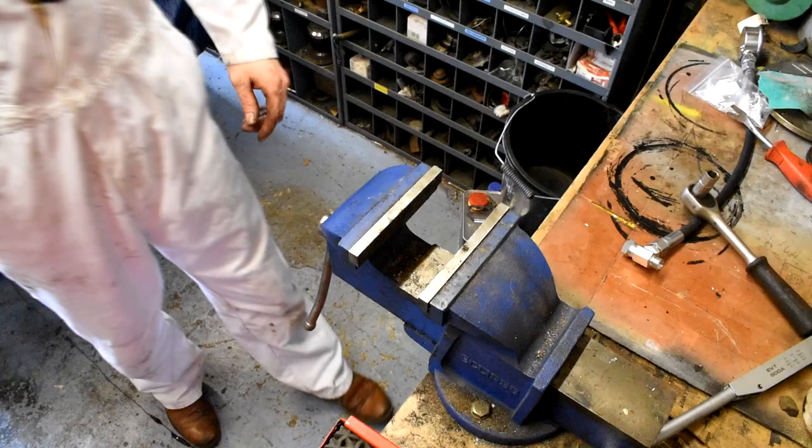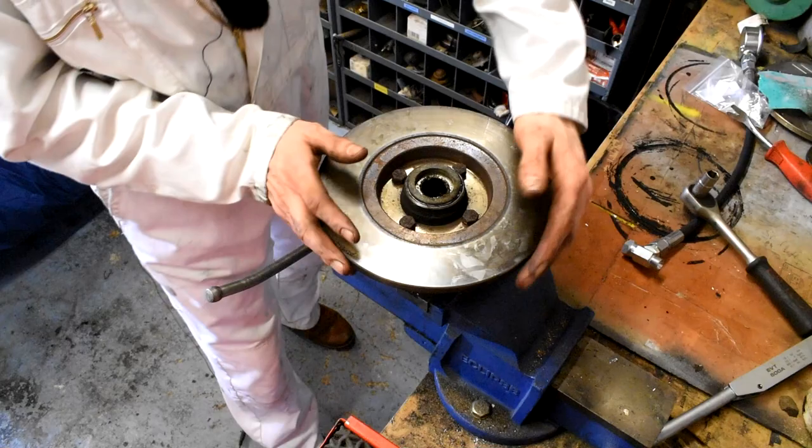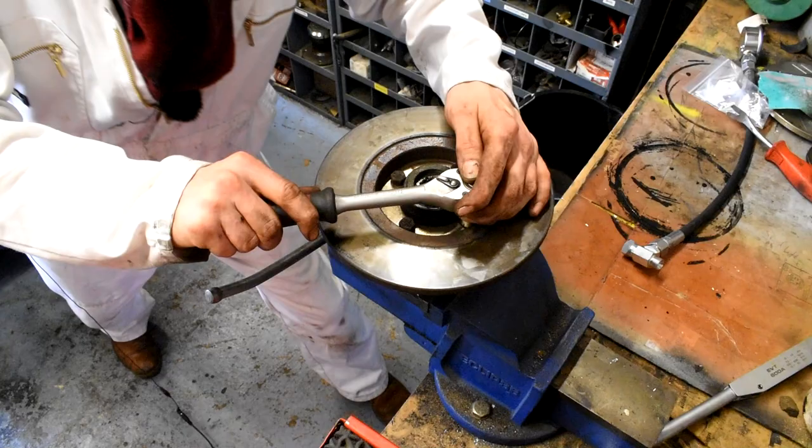Okay, if we put the hub in the vise here, and I'm actually putting the wheel nuts against the jaws of the vise and then just gently doing it up, not tight at all, so it's just to stop the actual hub moving as I'm undoing the four securing bolts for the brake disc. And these bolts here aren't actually done up massively tight, so it should be okay and it shouldn't damage anything as we undo them. They're actually 34 pounds feet, so if we get rid of these four bolts,